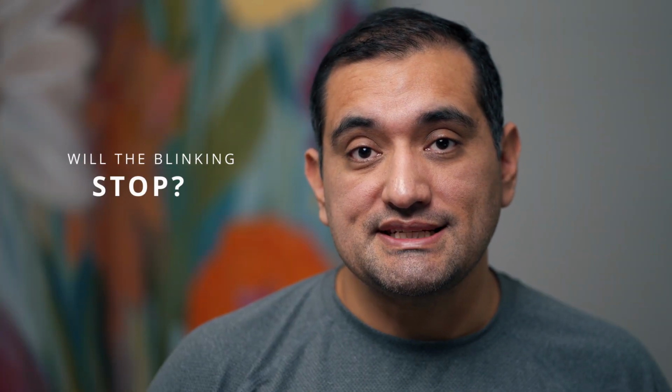After running Arc Genesis, I went ahead and tried to push the system again because now the crossovers were in place for the front stage, and so I figured that I might be able to get a little bit more out of it. However, I got to that same volume level and it started blinking again. I decided to reach out to Dylan from Buckeye Amps just to check and see if maybe I was missing something or if this was expected behavior. After all, the speakers were hitting 90 to 100 dBs on average at those levels.